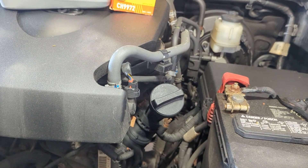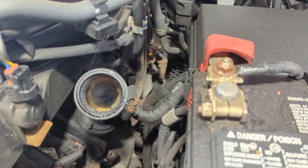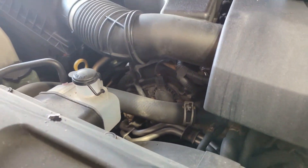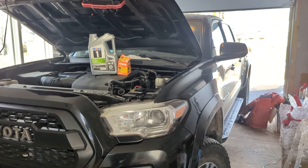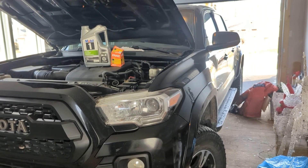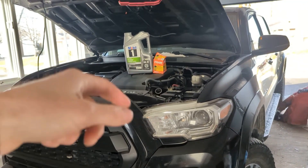The truck was not quite due for an oil change yet, but when I opened my filler I saw all this scum and stuff, which would kind of look like the end of the world — a lot of moisture in there. I don't think there's cause for alarm; my coolant level and everything seems good. The problem with my truck is that it does a lot of very short commutes. I start up, go to work which is less than 10 minutes away, shut it down, and I do a lot of back-and-forth. All these short jaunts, and especially here in the Northeast — it's winter right now, cold climate — that's really not good.